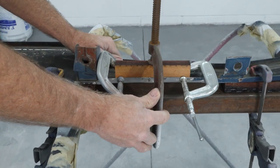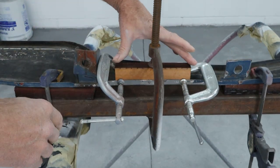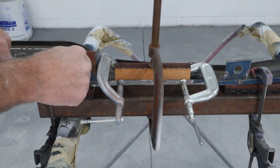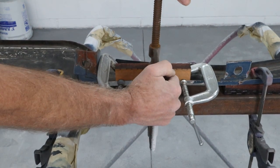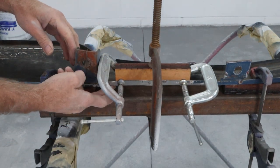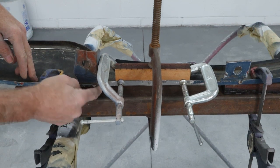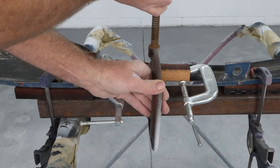The setup has changed slightly. I put a block of wood over here and here — they're both the same thickness. Then I found a little block of wood that's about the distance I want in between here. I've got it clamped up against the lip so it can't roll off and we're just pushing on that raised portion. I put a C-clamp on it and I position the block where there's a lot of kink over here on this side and it just kind of gradually goes towards the center. So I've moved the block a little bit closer to isolate the pressure right there.